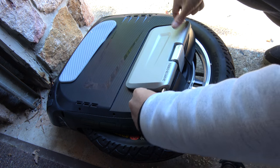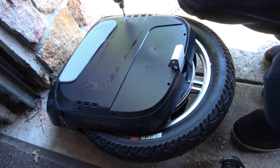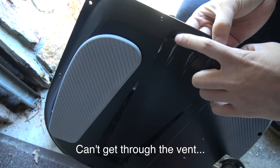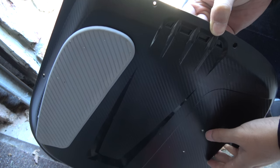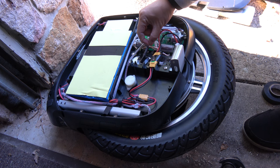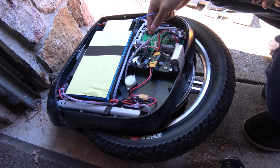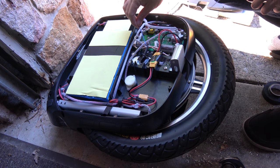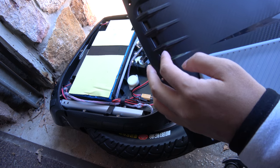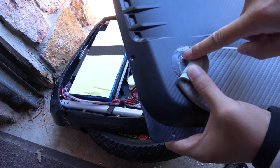Let's get this opened up, wire it, and close it back again. It's a good thing that Gotway has a hole in this vent so I can use that to route the temperature probes into the unit itself. So here are the wires — I'm going to try to just stick it in here and bind it to one of the battery cables and also a motor wire. It seems like I cannot route the cable through this part here so I drilled a little tiny hole behind the pad which I'll cover up later — this is where I will route the cable.